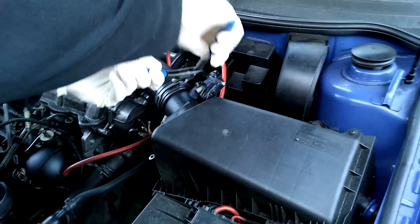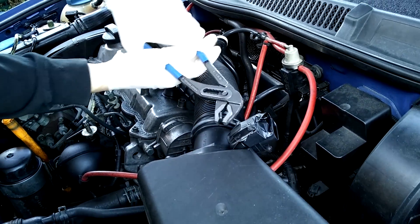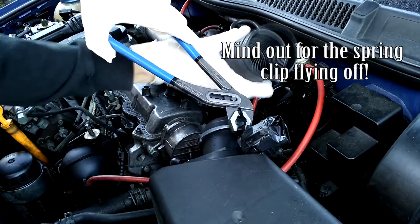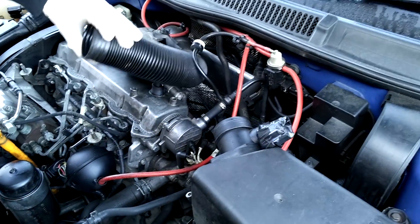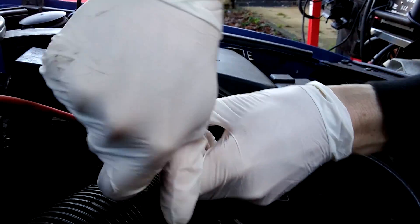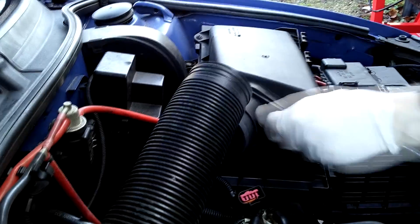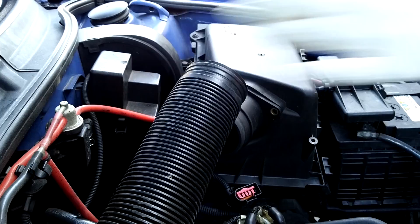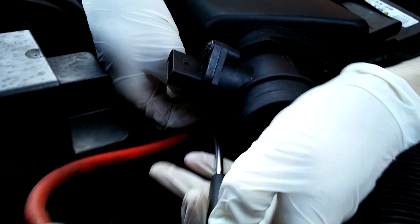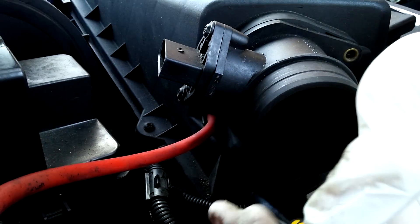With the diode mod above 3000 RPM I was seeing full — if not more — power, because the ECU was being told it was getting full air so it could put the full amount of fueling in. Now we're going to watch as I take the old MAF sensor off. You take the intake pipe off first — there are a couple of screws to undo. Some people have said you can clean MAF sensors, but I decided it was best to go with a new one. I went with one for about 28 to 30 pounds delivered — it might be a remanufactured one.